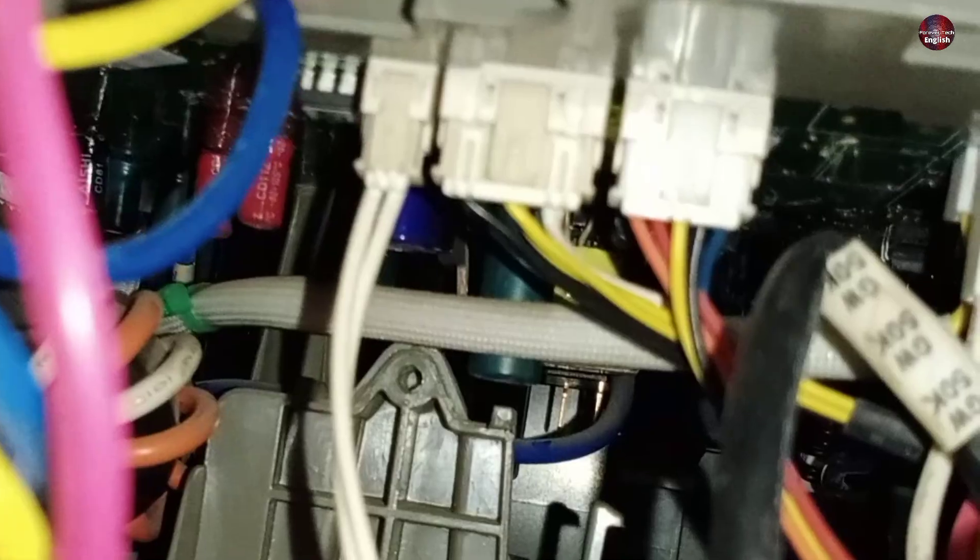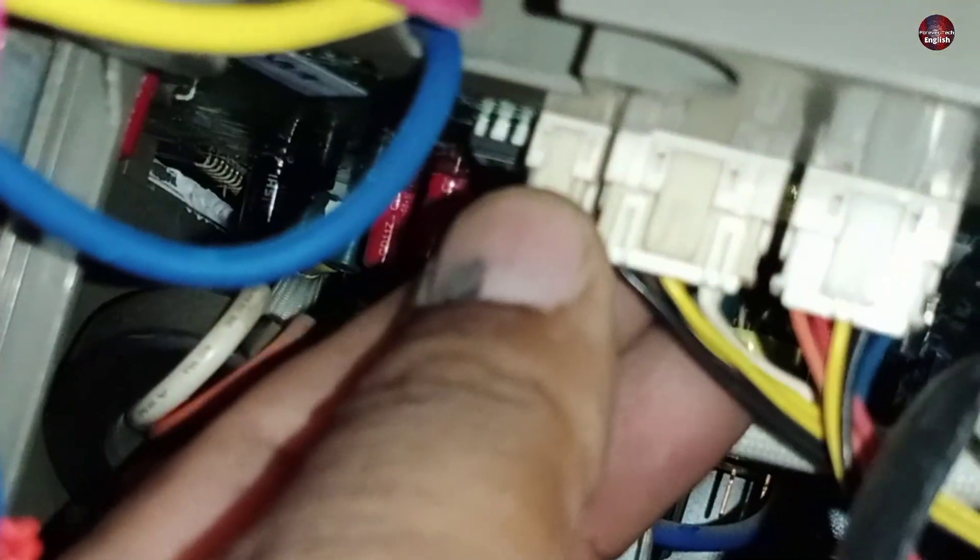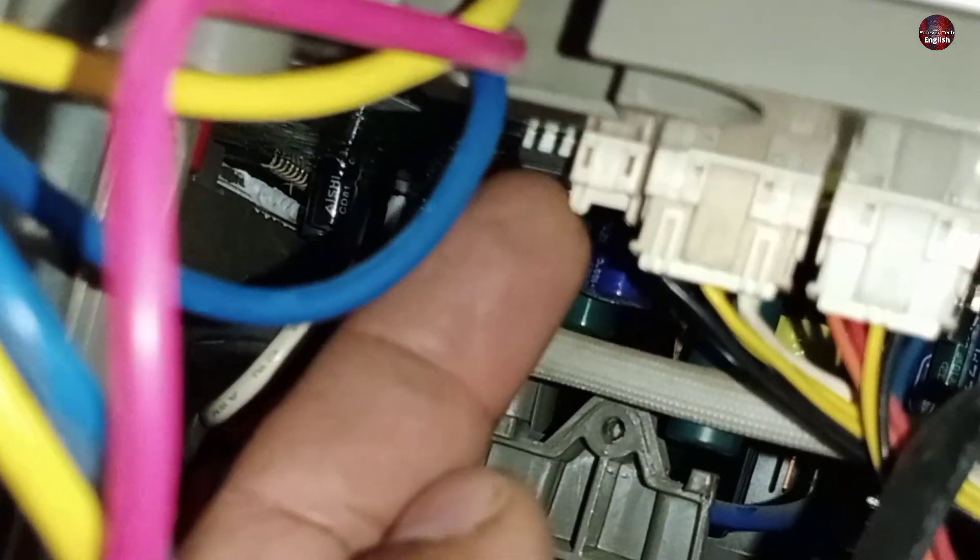I have come to the outdoor unit of this mini split air conditioner. You can see this white colored cable attached to the connector. If this wire is loose and not inserted properly in the connector, it can still show an H3 error code.